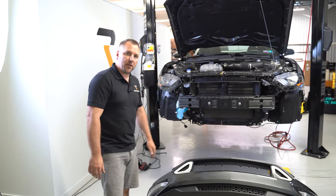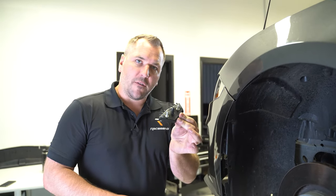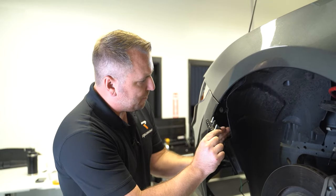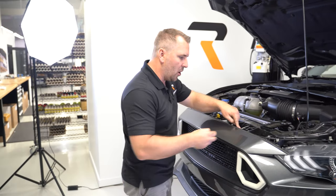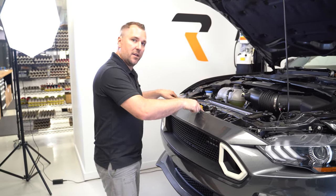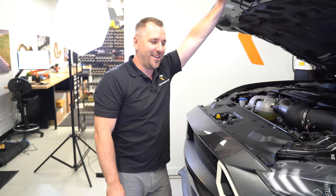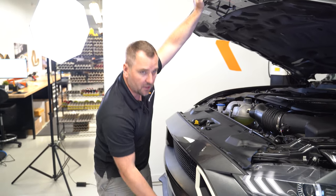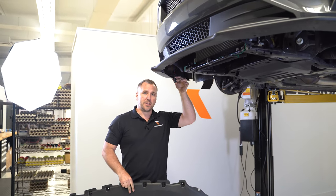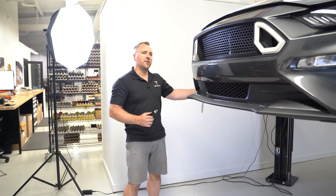With the bumper cuts filed and finished, pick it up and put it back on the car. Move the liner to the side, pass the fender to bumper bracket up through, and reinstall the two nuts. Reinstall all the bolts along the bolt locations. Put the bumper cowl on and reinsert all the plastic clips. Front bumper bolts are in place, cowl is on. Lower the hood slightly and raise the car to reinstall the air dam. Plug in any turn signal bulb connectors, then put the air dam back in place. Reattach all fender liner hardware.